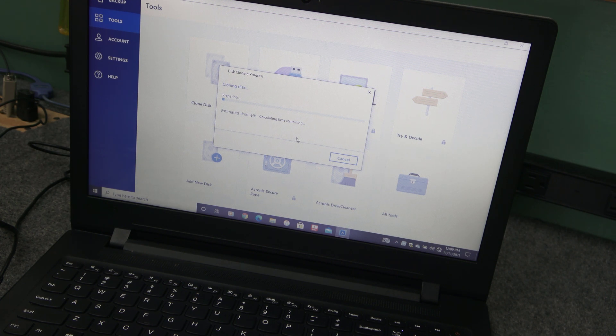Running that disk check — or you can boot into the Windows repair environment and run CHKDSK /F to do a check disk on your drive for any errors. Because if you've got errors of any kind, the cloning may fail. I've already done all that on this laptop. Typically we would just take the hard drive out, stick it in our cloning machine, and clone it in about 10 minutes. But I'm doing this to show you how you can do it yourself without any fancy tools except this little USB adapter.